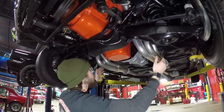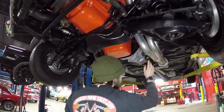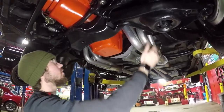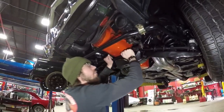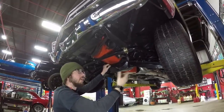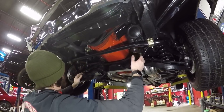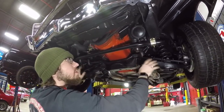One upgrade this car does have: it has jet-coated full-length headers on it. Looks about like a three-inch outlet; it does look like it gets sucked down to about a two-and-a-half on the exhaust. If you really wanted to uncork this thing, you could have a little bit fatter exhaust put on it, but the exhaust is relatively new so there's no reason to do so. Moving forward, looks like the front end has been done recently. We always fully check them out and give them the full shakedown. The pitman arm looks to be new, the idler arm definitely looks to be relatively recent, both inner and outer tie rod ends look nice, and there are new dust shields on the disc brakes in the front.